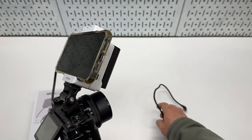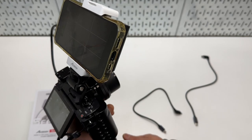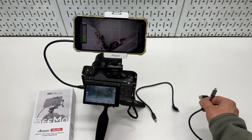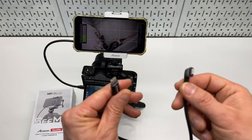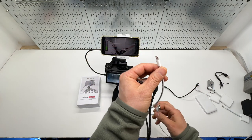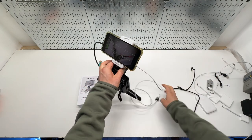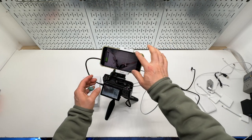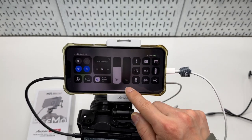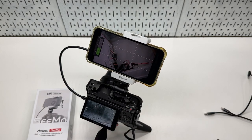The USB-C to Lightning and the USB-C to USB-C for connecting to the iPad Pro. The USB-C to USB-C cable is replaceable — I can use any regular USB-C to USB-C data cable for the iPad Pro with M1 chip. But the Lightning cable is very special. I tried the USB-C to Lightning cable and it will not work with the iPhone. The original iPhone cable will be able to charge the iPhone, but as you can see, it's going to be charging with no signal coming into the phone, so I cannot use it for monitoring.